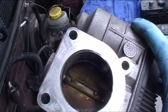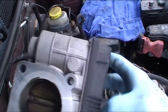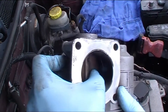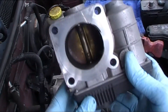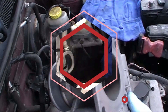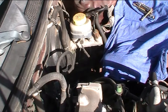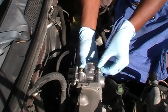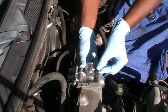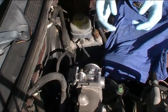You can see this body is really dirty inside. If you've seen that last video, you saw that I cleaned the throttle body and reinstalled it, and that did not fix my problem. So I bought a new throttle body and I'm replacing it in this car right now. What I'm doing is I put the gasket in together with the throttle body and put the two upper screws in just to hold it in place, orienting the throttle body in the correct position.